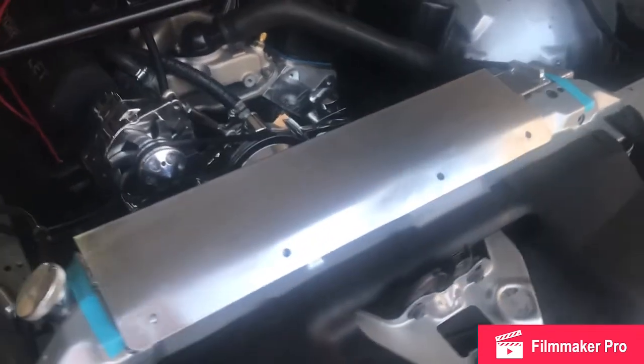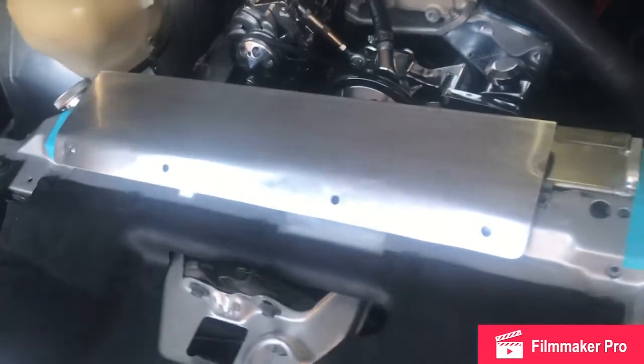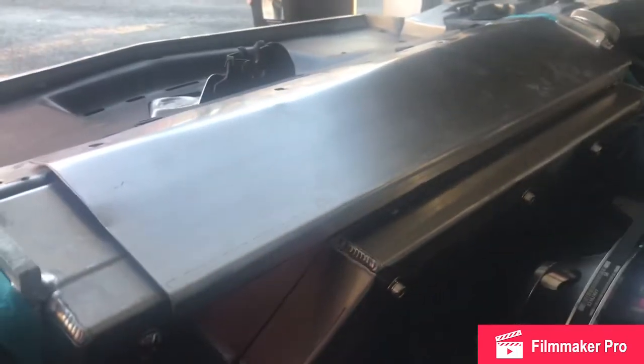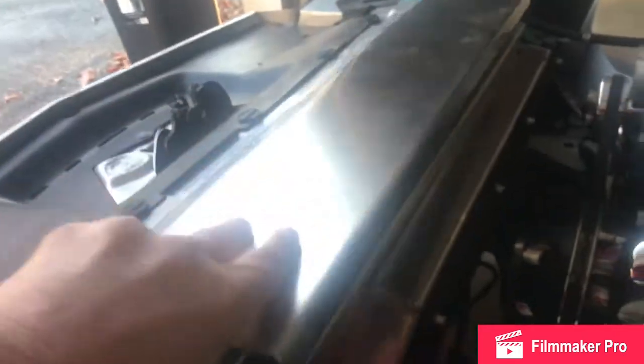The third option we came up with was simply bending up a piece of stainless steel and drilling some holes in it for the factory mounts. This will be a nice fit on our radiator. We've made it so it just overhangs by the fans and won't interfere with anything — a nice tight fit to the radiator. We've also added some foam to the inside of it so that it won't be metal to metal, providing a nice cushion and absorbing some vibration.